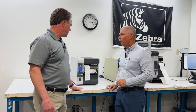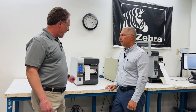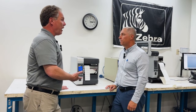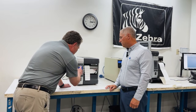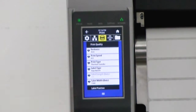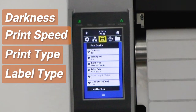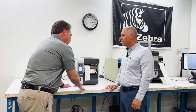Defaulting is going to reset some sensor levels and things like that. The good news is it's not going to change your network settings, so it's not going to take you offline or anything like that. First thing I would recommend is when you go to menu and printer settings, you want to jot down these first four, because they will be reset: darkness, print speed, print type, and label type. Write those down or take a picture with your phone, and you'll reset those later.